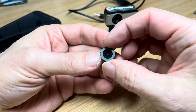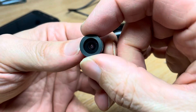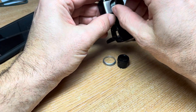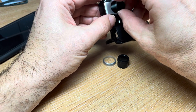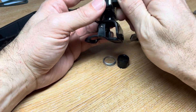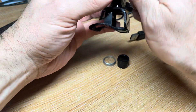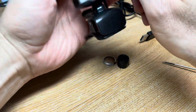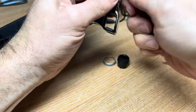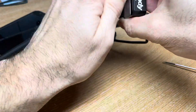Putting that one to the side, we'll use this lens. These are better quality and you'll probably get a higher level of light through this as well. Whilst you might get a shallower depth of field, this lens will be far superior for night vision. Just be careful not to cross-thread it — if you keep twisting it, you'll feel when it's right. If you don't get it in square, the problem is we won't get it focused correctly.